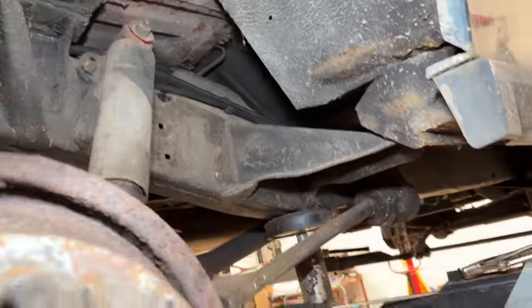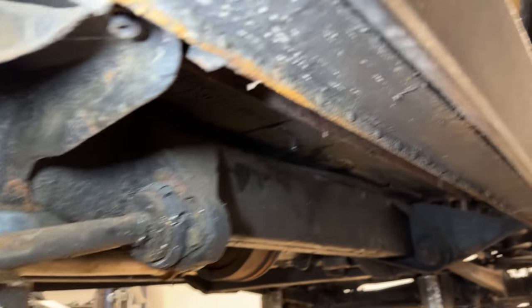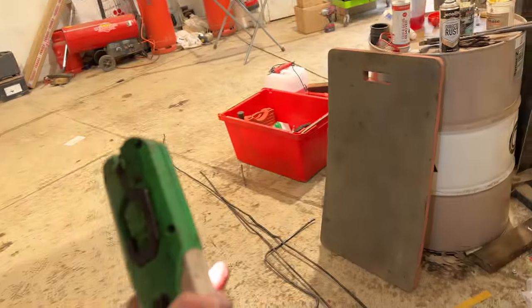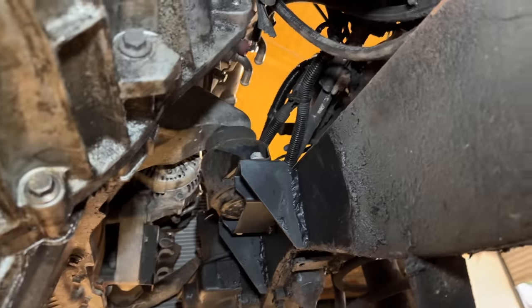I've had to get rid of the rest of all the P-clips, but we've run all the fuel lines in the factory way. The original factory lines had a bit of conduit here that went over just here. You can see it's down the floor there. We had a bit of conduit, so it stepped round that section. So we'll probably protect that somehow. We've got to get some P-clips anyway and P-clip this all up. But all of this now runs up to the fuel pressure regulator and the fuel cooler like a factory car.